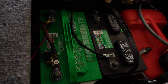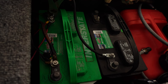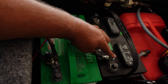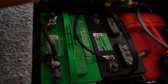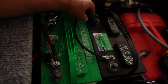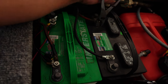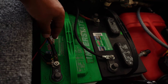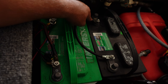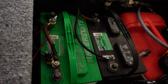I'll figure out how to run this wire so it's not in the way — pop it in right there, put the nut back on, tighten it down. Let's call them Battery A and Battery B so there's no confusion. Battery B is the new battery. Negative on Battery B goes to positive on Battery A — that's the first part of running in series. My positive trolling motor wire goes on the positive side of Battery B. You don't have to put anything else on that terminal. The negative coming off the trolling motor stays on Battery A.